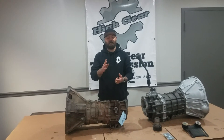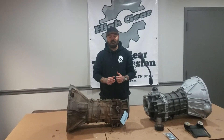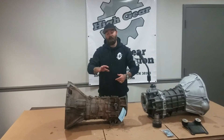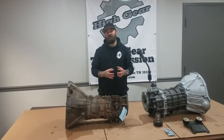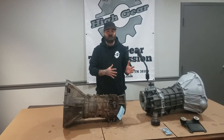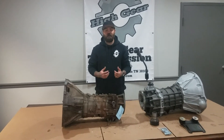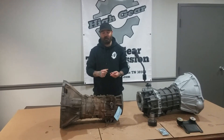The 4.0 motor was in 87 to 89, and the 4.2 was 87 to 90. The BA10 is an old, outdated unit. It's got some differences internally and externally compared to the AX15. The main difference is the synchro assemblies. On the inside, your synchro assemblies are a cup and cone design — a poured design made out of aluminum. They're not made out of brass or steel fiber-lined, which are the common materials. Because the aluminum is soft, they fail, causing sticky shifting, grinding, and ultimately complete failure.